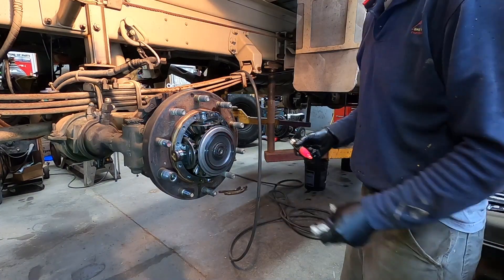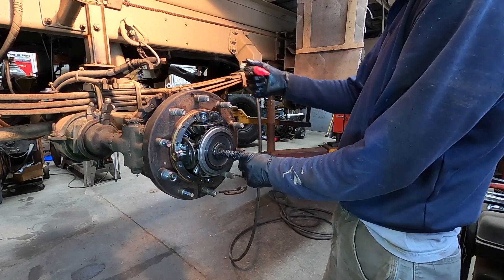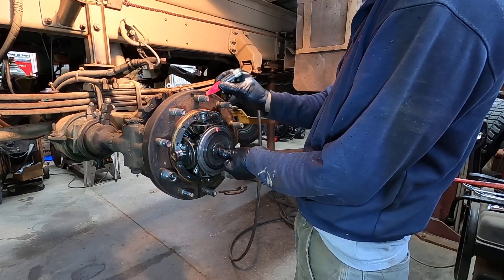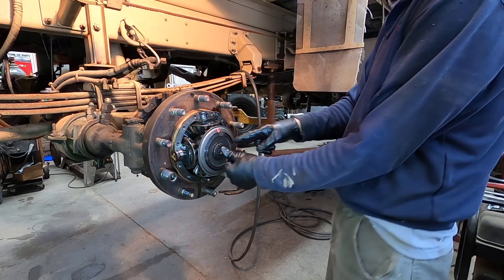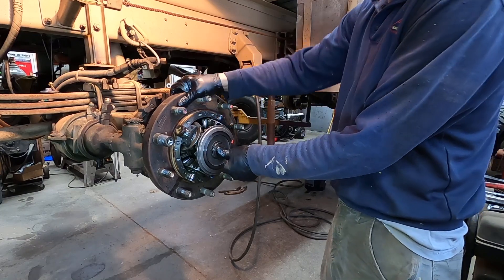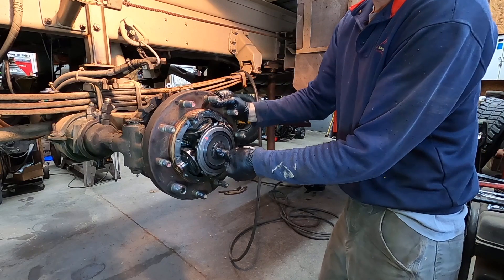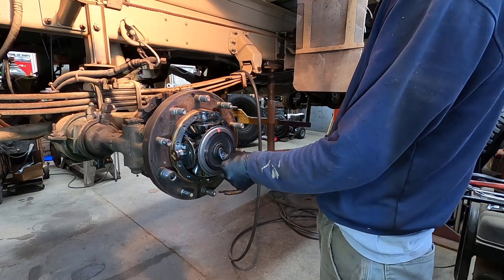Somebody asked me if I could do a little tutorial on what's going on here. This is the end of the axle coming from the rear differential, powering this outside gear. I'm going to mark this gear and this stud. When the power from the engine turns this — one rotation — and that stud's at the bottom at two rotations, we're back. So it's a two-to-one gear reduction right out here on the end of the axle.